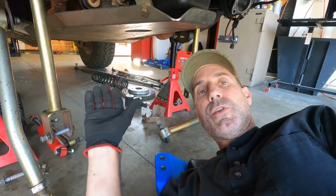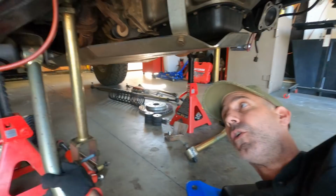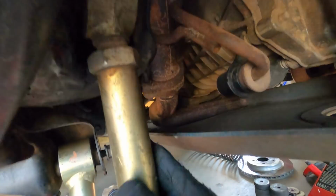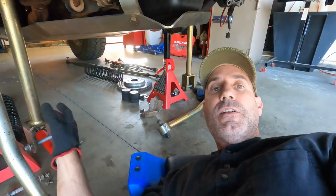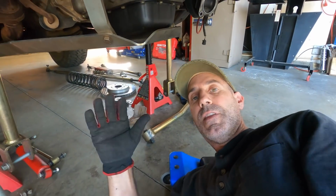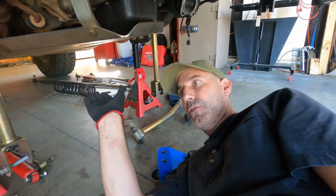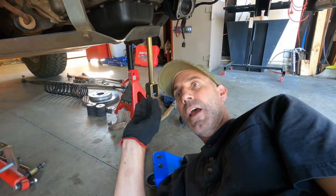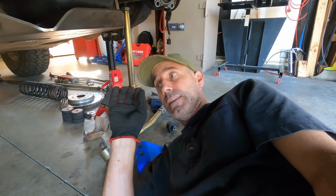Whenever you're doing anything with your Jeep, with your suspension, on any vehicle, you always want to loosen up all of the control arm bushings here, so that you only final tighten those with the weight of the vehicle on them, so that they're all in the general starting position of their intended use. So loosen those up. Those were tight and they would, for all intents and purposes, be fine, but this is one of the things that takes things to the next level on any of your mechanicking duties that you try to attempt.